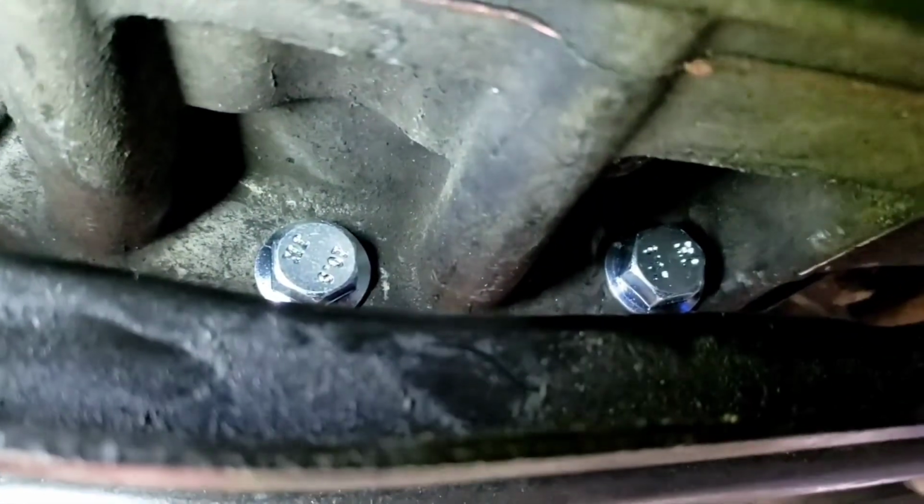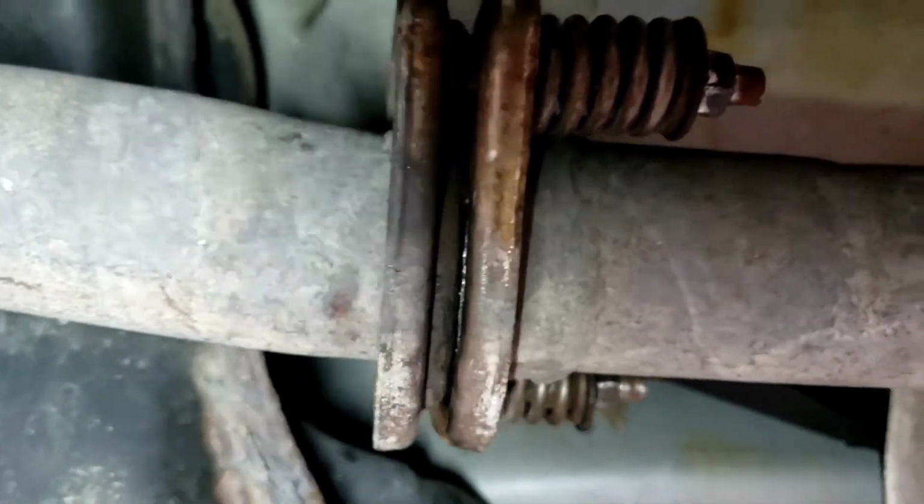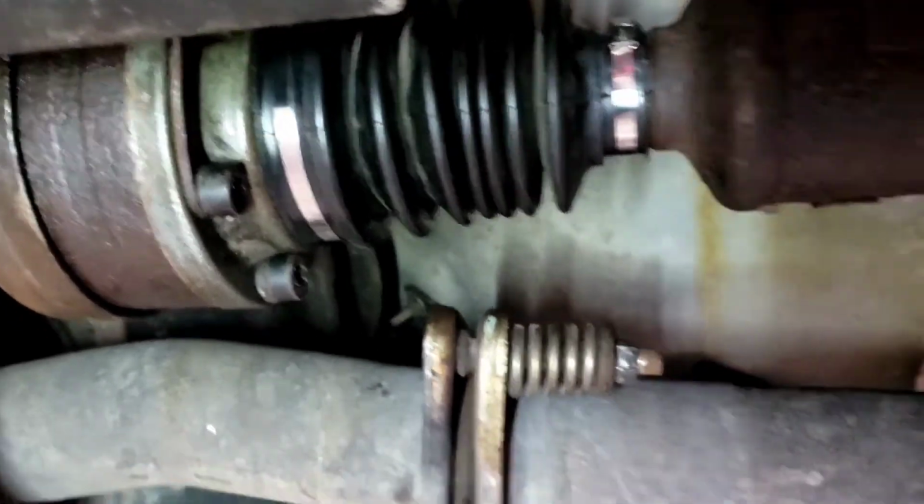But we got the bell housing bolts back in. We went and bought new ones. The flange heads. Put the nuts on the exhaust there. The bolt through there for the exhaust. New exhaust donut. Put that in right. Rebuilt the flex joint. Put the bands on it. Torqued them all down. Hung the muffler back up, front and rear. We tightened the struts up on top.